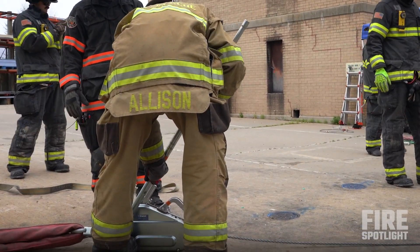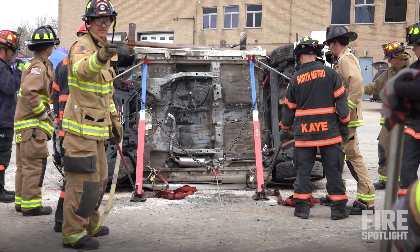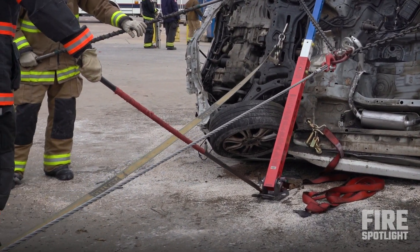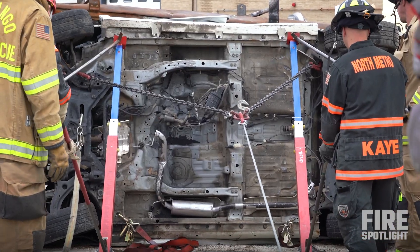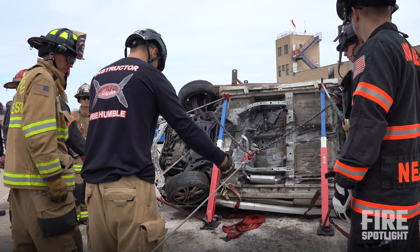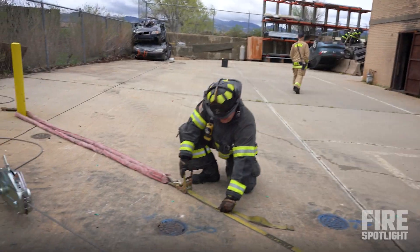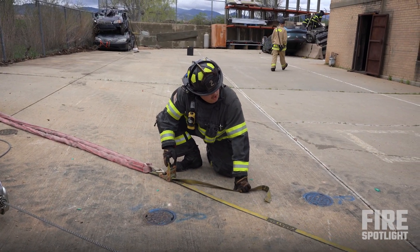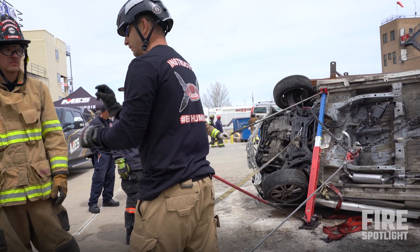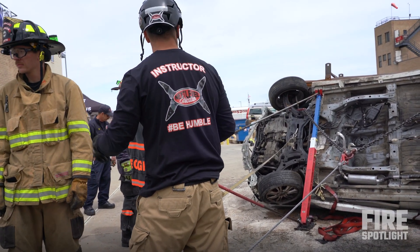You can go ahead and start taking a little bit of tension now, and we're not going to officially go until one person's in charge. You're watching them pulling the bases. You're watching these guys and making sure that they're pulling tension on the heads where they're actually engaged in the vehicle. You're making sure that nobody is standing in here by this cable because this is the most dangerous part. This thing does not even need to be messed with until this car is where we want it to be. Then you'll pull that through, but we need to make sure we have enough slack to get two full wraps around the bail, and then make sure it's locked off — that's our security.